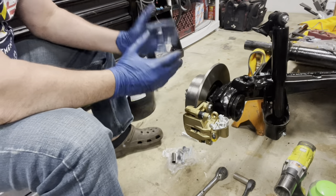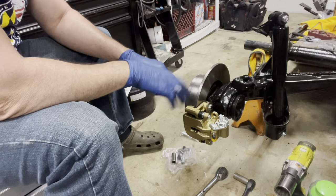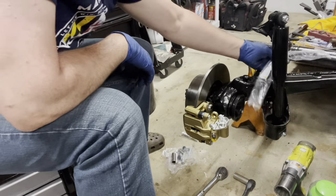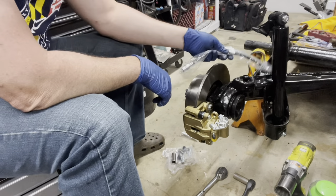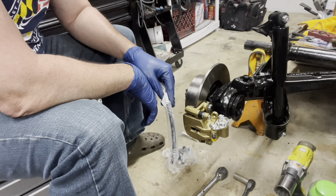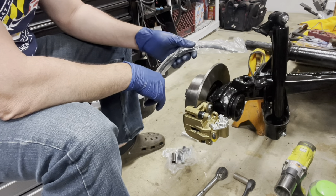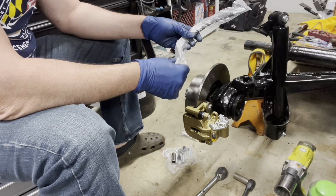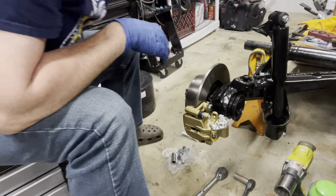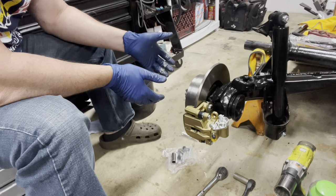That's as far as we're going to go tonight — but that's a big deal! We have rear discs on the car. I don't have the rest of this plumbed yet. It came with a replacement short 35-millimeter brake hose that goes here, and then I need to finish my hard line that'll run down around and into the back of the caliper — easy enough to take care of off-camera. Then we'll bleed the whole system. Right now the system is dry, so we'll bleed all the brakes together in one video and I'll show you some cool tricks for that.